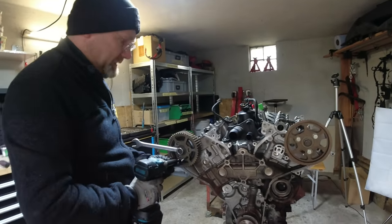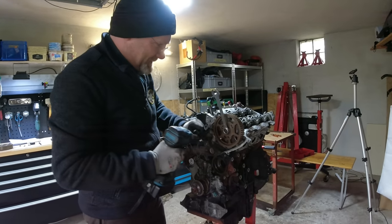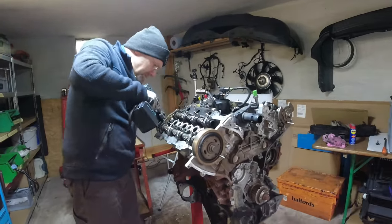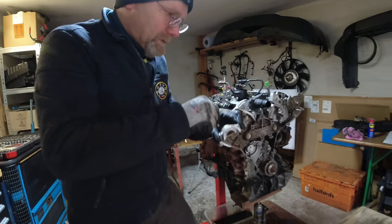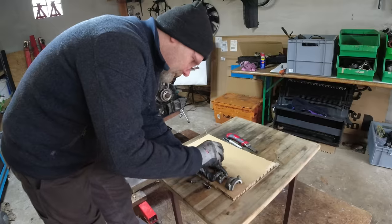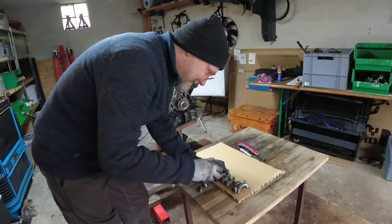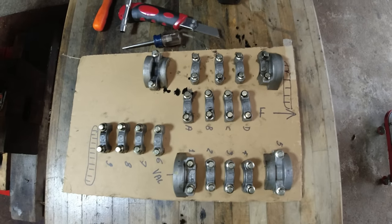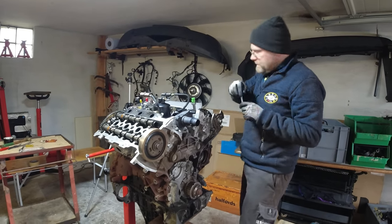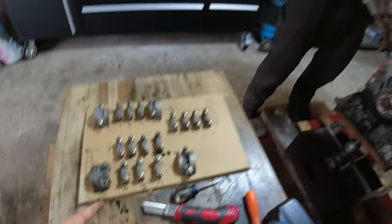The camera girl is back - tripod work is boring. Now it's the camshafts out. Lots of bolts - we're laying them over on a piece of cardboard in exactly the correct order and labeling them. We do intend to reuse the cylinder heads; the block is wasted - it has a hole in it. Everything is labeled: that's the front of the engine. We take the timing pins out. We already inspected them - they're good.